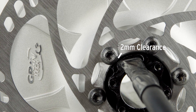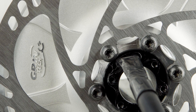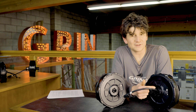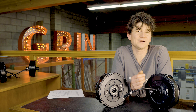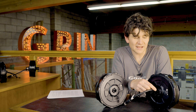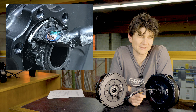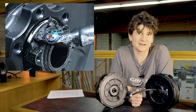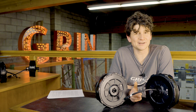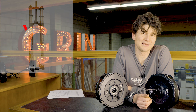The reason for this is that in an effort to support both a 20 millimeter thru-axle and have the cable exit on the same side of the disc rotor, the entire cable has to exit through a very narrow area. With the disc rotors and disc bolts that Grin provides there's just enough clearance, but if people use other brands of disc rotors or an M5 screw with a larger head or a washer, there's always a chance that the washer or disc rotor can rub against the cable guard and eventually wear through the cable sheathing and short out the wires.